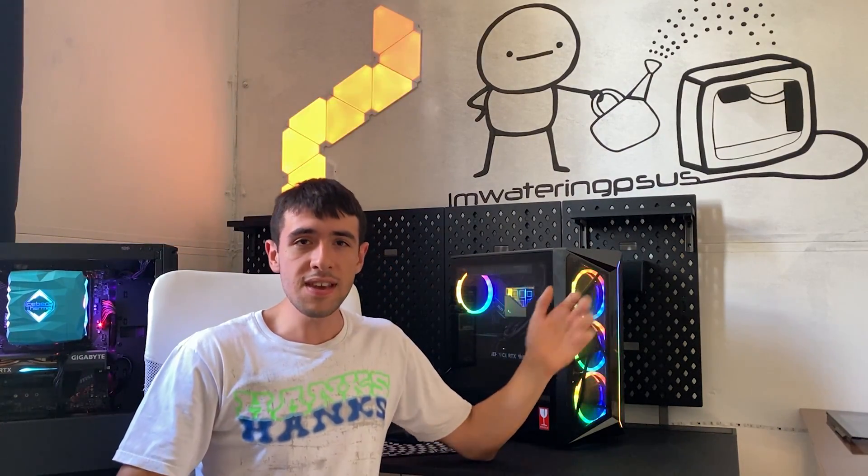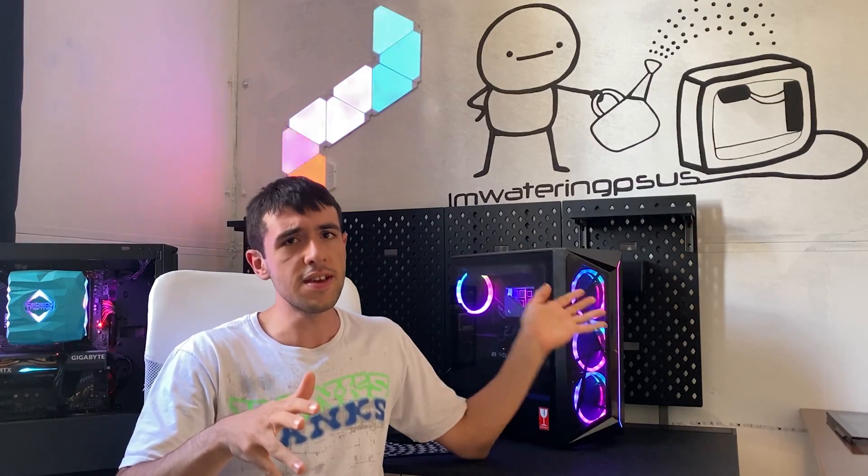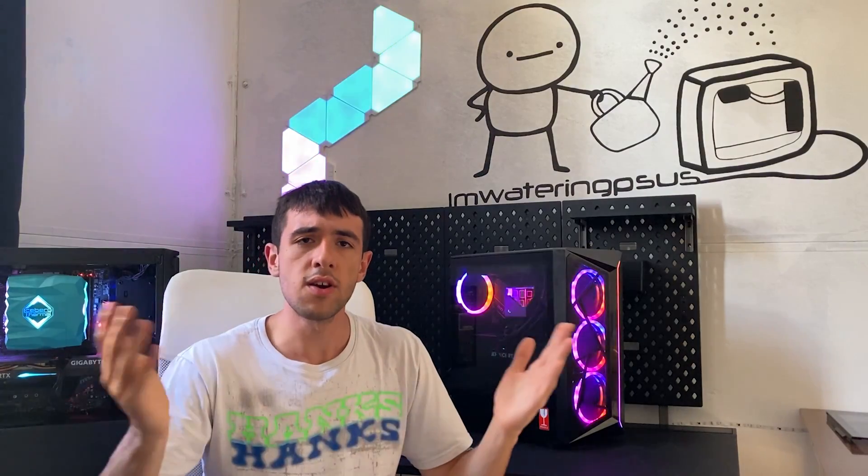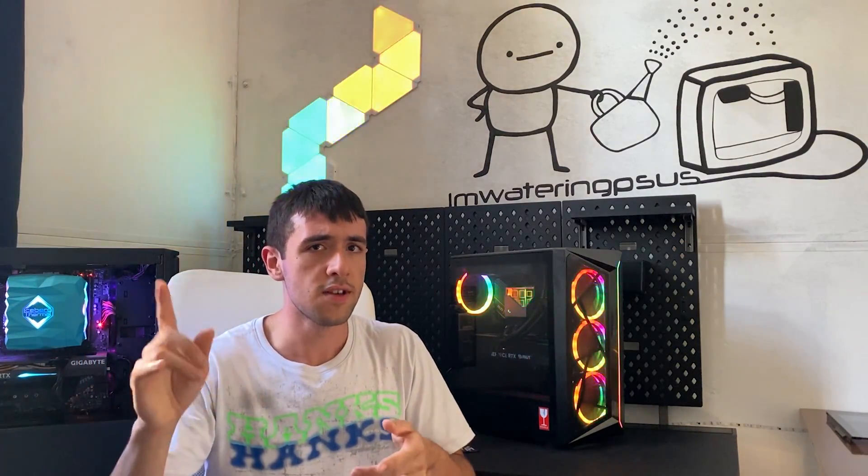What we have here is a very high-end PC, around 3,000 euros worth of PC, with a 13th gen i9-13900KF. However, they built it with a 240mm all-in-one water cooler from Deepcool, which — even though it's good, I have it in my personal build, the 360mm one — it's not enough for the i9. It has too many cores and pushes the clocks too high. So we need to change a few parameters in the BIOS.